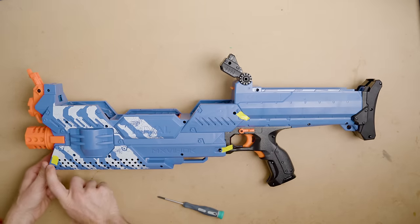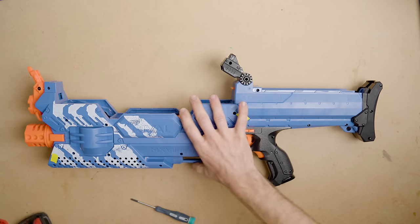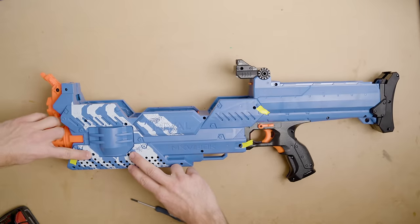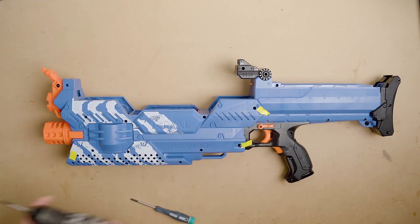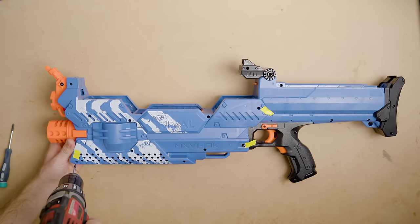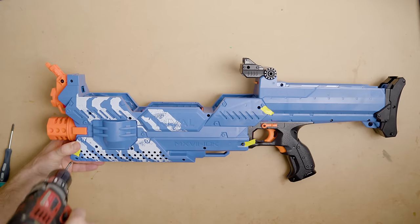I've successfully removed all screws except the front one, which is typically the most stubborn. Even with my cautious use of the correct screwdriver, it has locked itself in place. You have two options: if you can spread the shell enough to get in and snip it, that's totally acceptable — with three other screws nearby, you won't have a problem missing that front screw. I'm going to try a reverse-threaded screw extractor, which works like a drill in the direction of removal, running it counterclockwise.